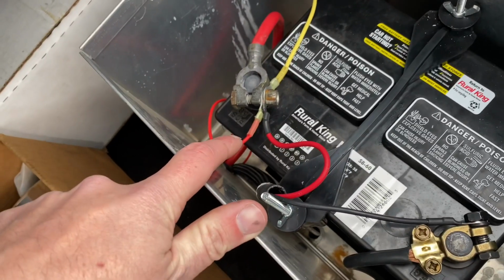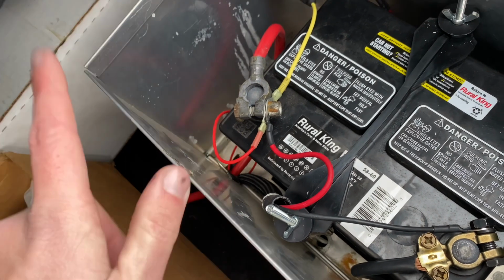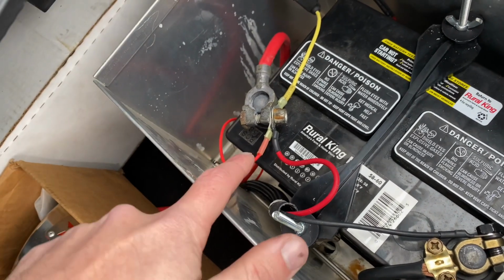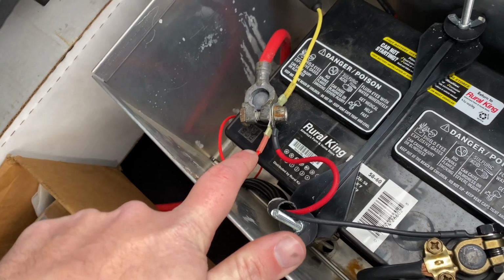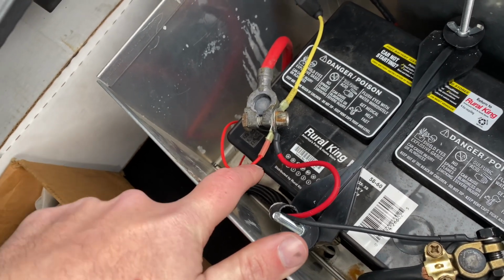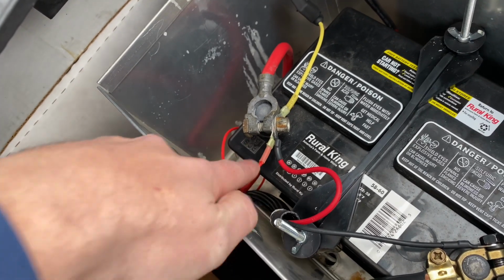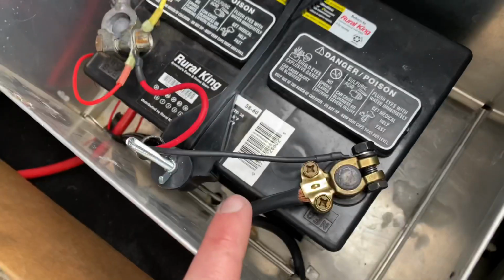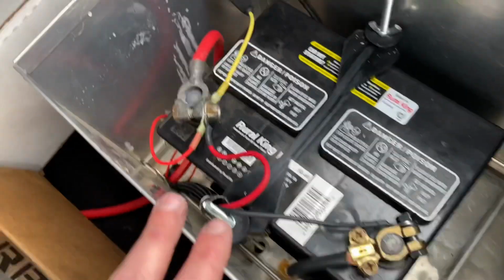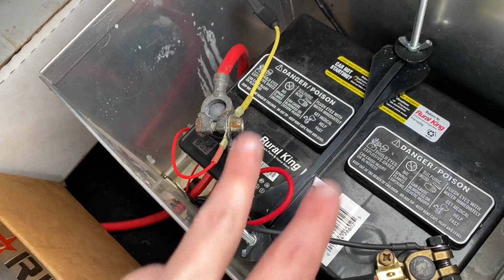There's also a red wire that feeds the fuel pump relay, which you guys saw in that little bundle of wires I had up there. That relay was the fuel pump and coil power relay. That wire, you can extend it and just run it straight back to the positive terminal on your battery as well. And that's what this one is. So you just need to make sure that those two wires are connected directly to the battery.